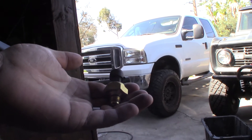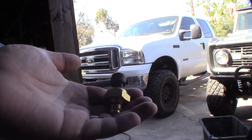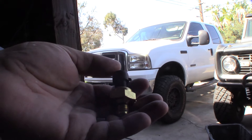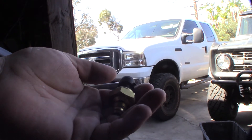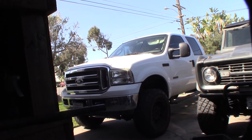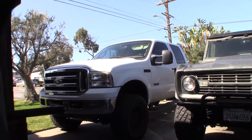What was going on was it was actually reading, but it wasn't reading right. So it was throwing everything off a little bit — it was throwing my turbo, the VGT duty cycle, way out of range. It was also giving me the turbo intake backfire and making my idle surge. This video is about my idle surge.